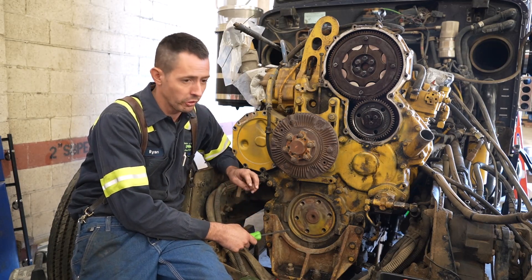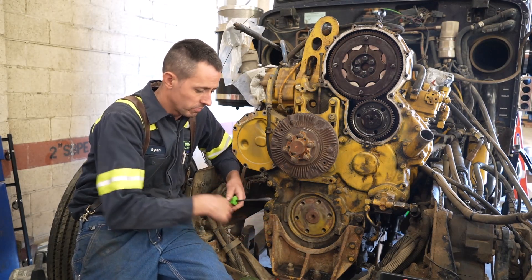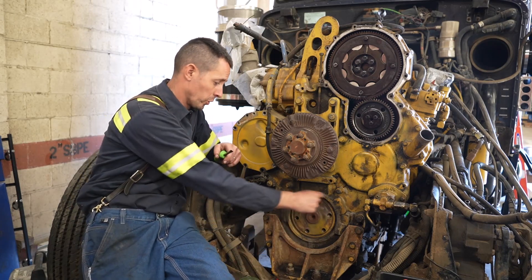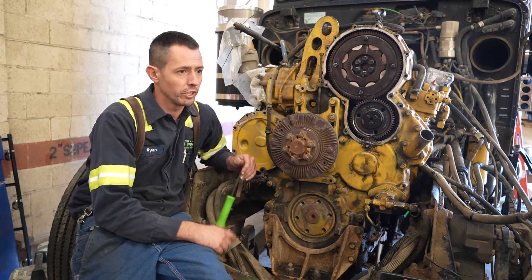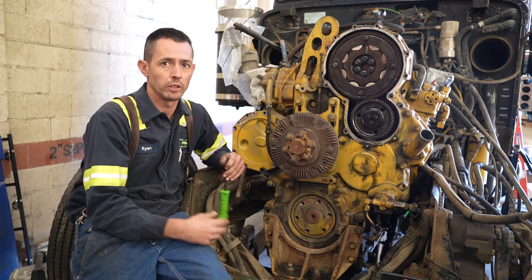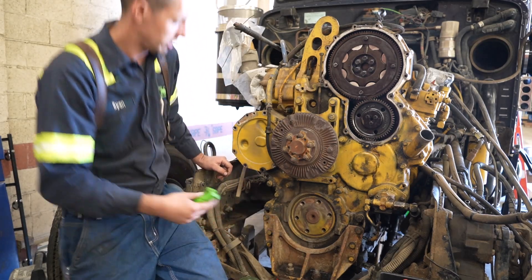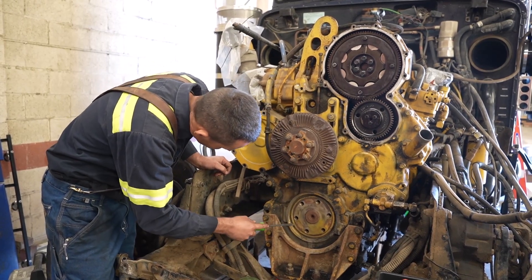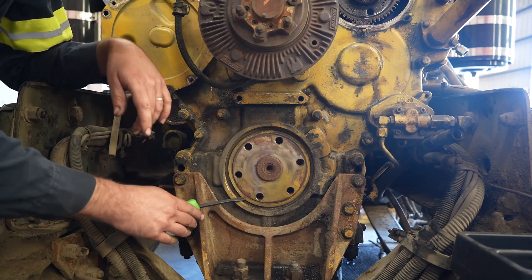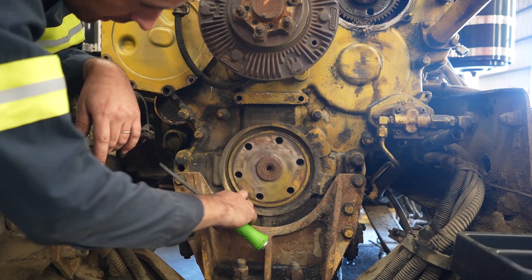With these ones, you've got to kind of pry them out a certain way. You've got to be really careful when you're doing it because this area around here is all aluminum, so you've got to get this pried up a little bit really carefully. Then we use a pair of channel locks to lock onto it and pull it against the crank, because the crank's hardened steel, and you just keep working your way around until you finally get it out. This is like a chamfered edge here, so this isn't actually where the seal sits.